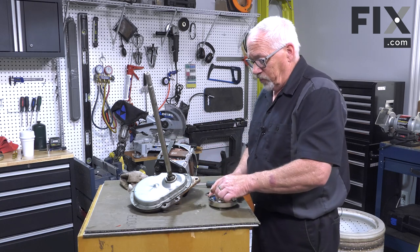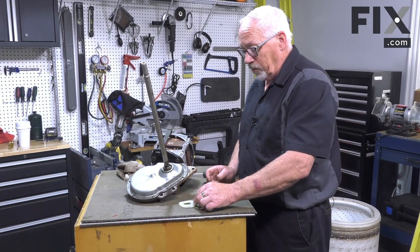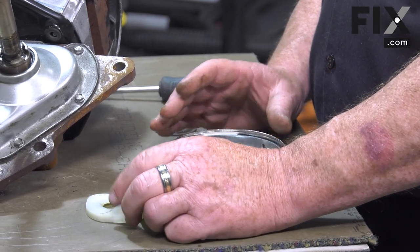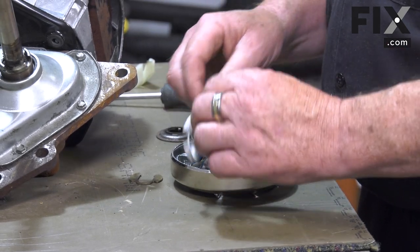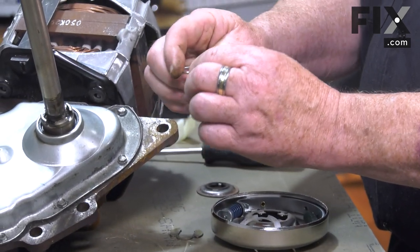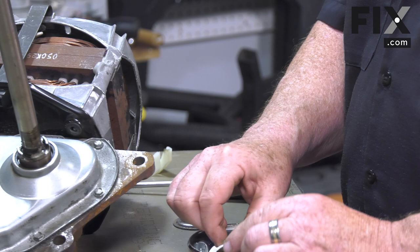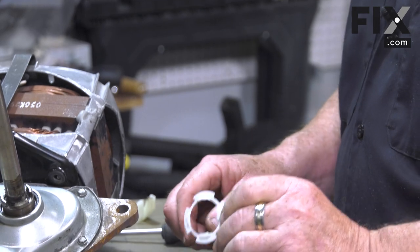If you purchased a new clutch, it's going to come with some extra pieces. It's going to come with a new cam that will go onto your basket drive — they're giving you this in case yours was broken when your clutch failed. It also comes with a new retaining clip, since prying the old one off may have reduced its tension. They also give you a new plastic collar for underneath, because sometimes they wear or may have broken when the clutch was removed.